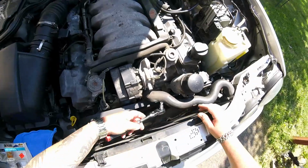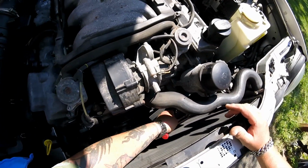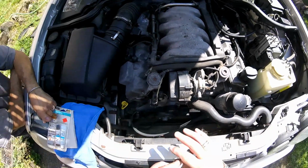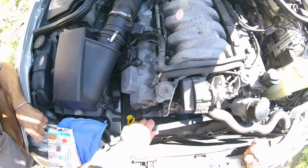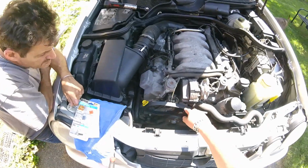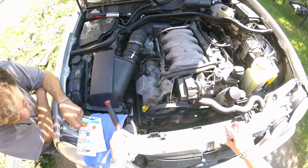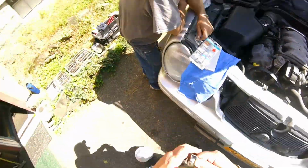I'm just going to put this E10 right here down on the tip of that tensioner. That's a little E10 stud. Then you go counterclockwise, lift your serpentine belt off your idler, then get it off your alternator. I have a brand new belt on here, but if you don't have a new belt, it's a good time to inspect your belt and replace it while you're doing the job. I believe these are E14s.